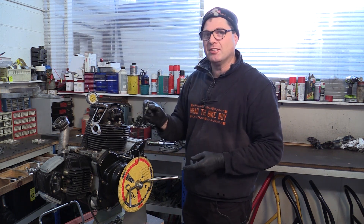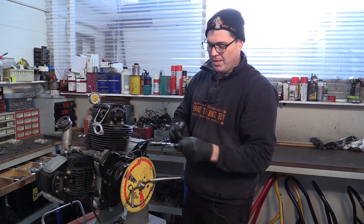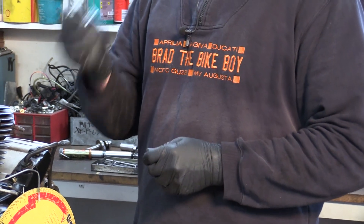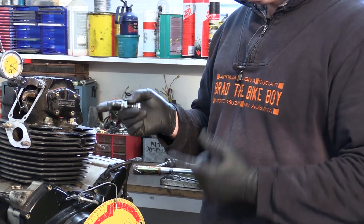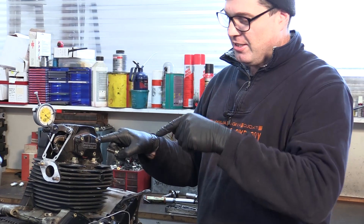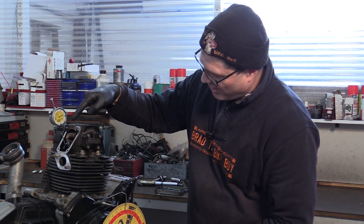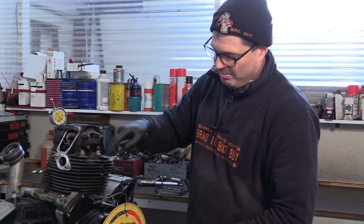On a 900, it will hit the inlet valve because the inlet valve opens up and can open into the tool, and because this is stronger than the valve, you'll probably bend the valve. So to make sure the inlet valve isn't going to hit the top dead centre tool, we use the tool between top dead centre firing and top dead centre overlap. In that instance, the exhaust valve opens but it doesn't come far enough into the cylinder to hit the tool, whereas you can see the inlet valve if you look through the spark plug hole.